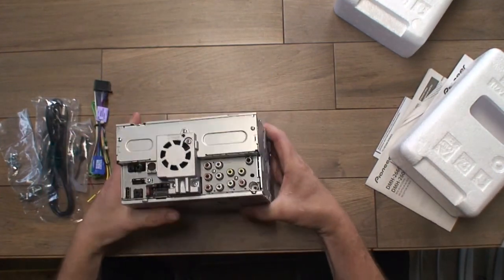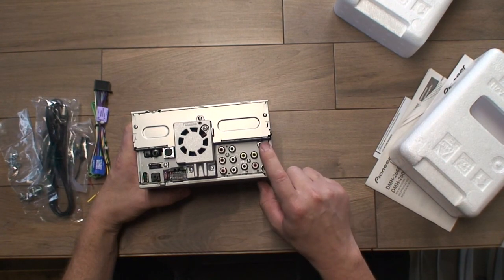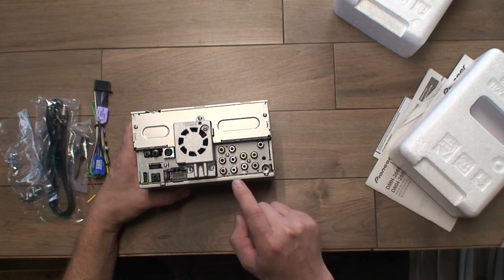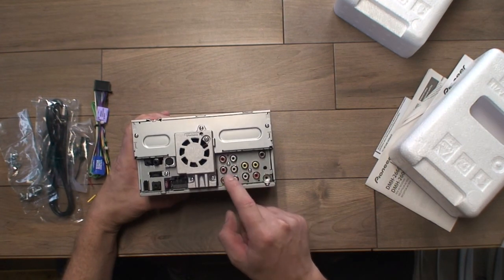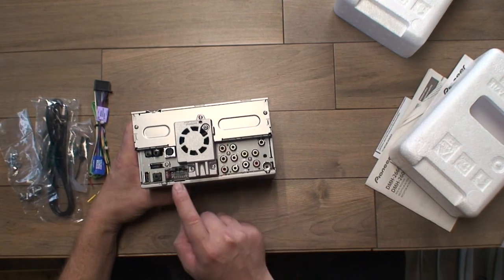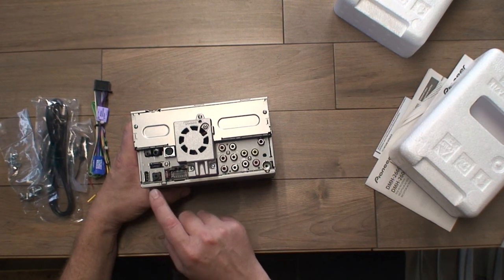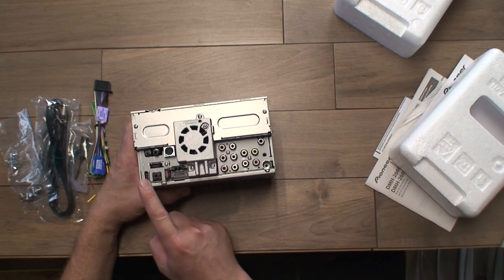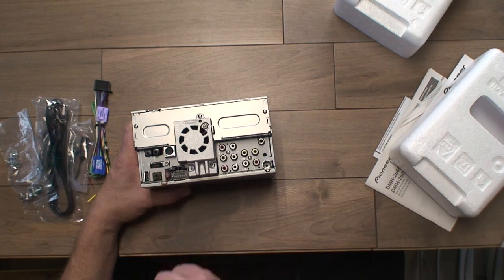Once you turn it over here, you get all your goodies, okay? So you got your reverse camera input, your video out, audio out. And here, I believe you have your subwoofer, your front, your rears. You got your connector for the main power harness and speaker harness if you're going to be going the high level route. Here you got your AV input, USB input. The 4-pin connector right here is the iDataLink connector if you're going to be hooking up a Maestro module